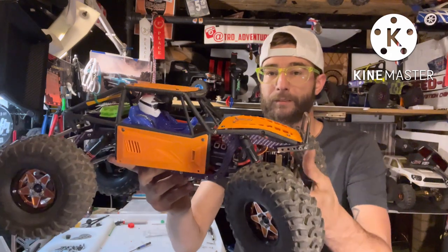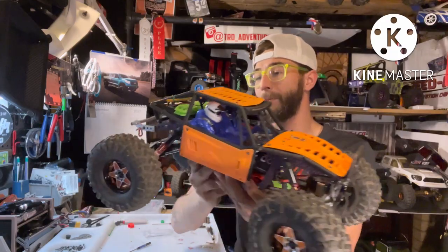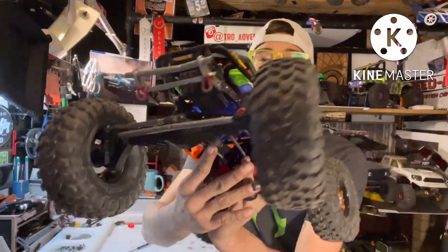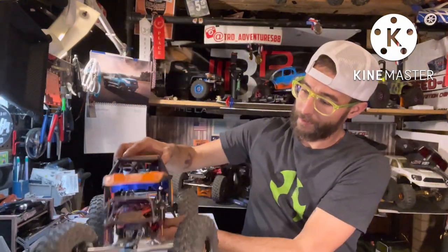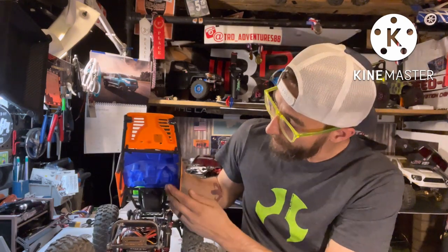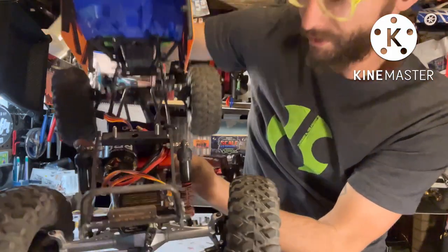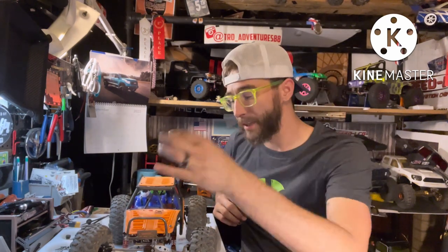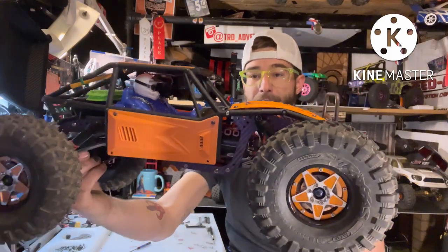Oh, that's done. That was a lot easier than I thought it was going to be. So I just mounted right back here, at that last spot where the fuel cell was. Used a couple spacers on each end. Then here does tilt up. I went ahead and removed the front grill just to get it to hang down a little bit lower. I have a custom 3D printed spacer there that I used some M4 nuts through, and I will use some ProLine screw caps, and blam, just like that.